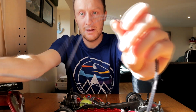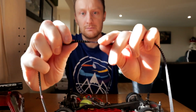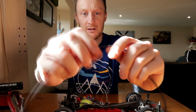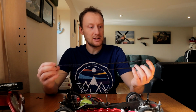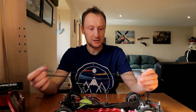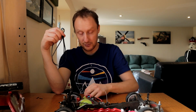The belt is knackered. See, there's broken there, don't know if you can see that. There's a tooth missing there, teeth missing there, and there, and there, and there, and there, and there. Basically, as I was driving around the floor, it started spitting teeth because the car has been sitting for nearly 5 years since it was last run, and these Losi belts that came with this car, particularly, not the later Losi models, there's another tooth just fallen off.